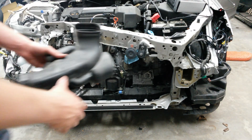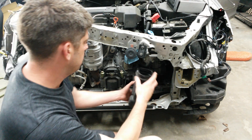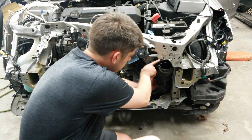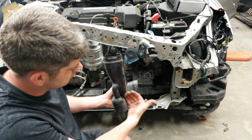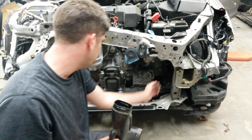I've just about gotten to where I can get the radiator support cut out. I had to take this air duct — it goes through here over to the resonator — took the one bolt out here under the battery tray, got that out of the way. It was covering up where the radiator support welds in to the subframe mount under here on the frame rail.